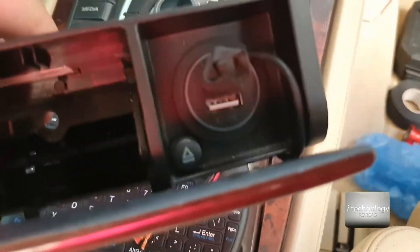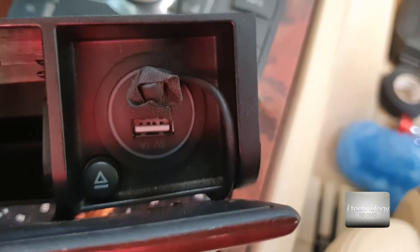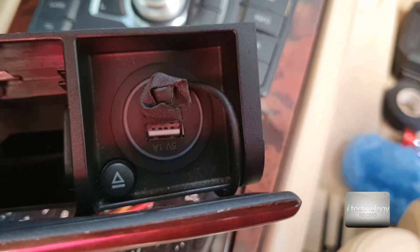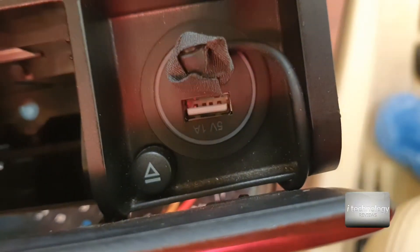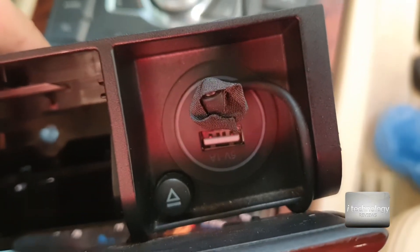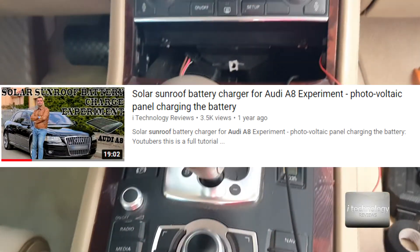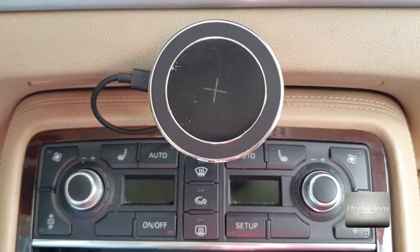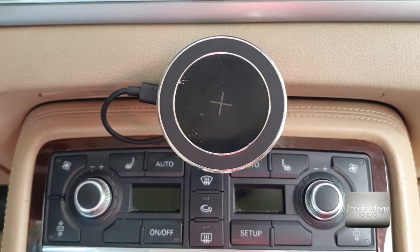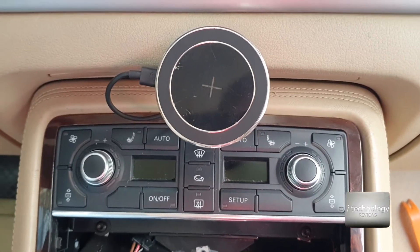Here's what we're going to do, because the Audi A8 has all the sockets active. This is another problem, because if you want to use a wireless charger, when the car will be locked this port will consume 0.03 amps. So it's not good — you'll have a static power consumption. Of course in this car we have the solar sun roof that charges the internal battery with solar energy, but this is not enough and I want a good way to conserve the battery.